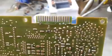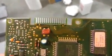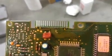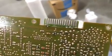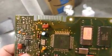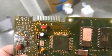It's important to note the two sides of the edge connector are not the same — they're separate pins, so you've got to do both sides. The bottom side is much thicker and harder with more tin to work with. The top side is actually super thin, so do a very small amount of scuffing on that side because you don't want to go through. Scotch-Brite a little bit at a time, and the minute you see copper you need to stop — preferably stop before you see copper. On the front side of the board it's really thin; on the back side it's really thick and you can't get through that very easily.